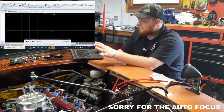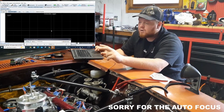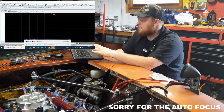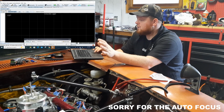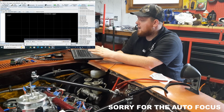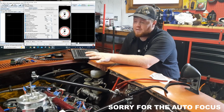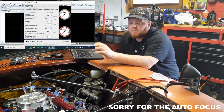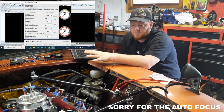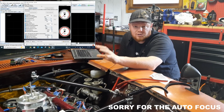That being said, after you've made sure that you have your crank signal, you can then go into a couple of different things from here. For me personally, I kind of did this backwards. If you watch the Jim Stim video, then you know that in this test mode, I went down to the output test mode, and from this menu, I bench tested to make sure that all the outputs on the MS3 were working correctly. Now, because of all the diag problems that I have had, I went back into this mode, and I've actually pulled the fuel rails and I've pulled the spark plug wires off of the vehicle.